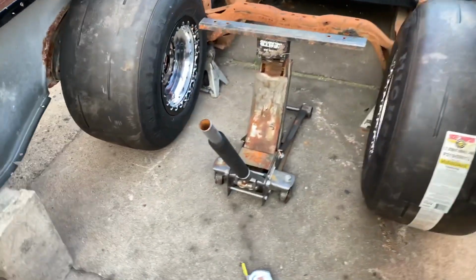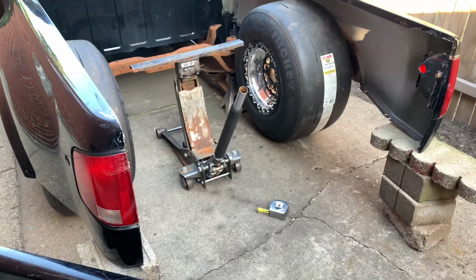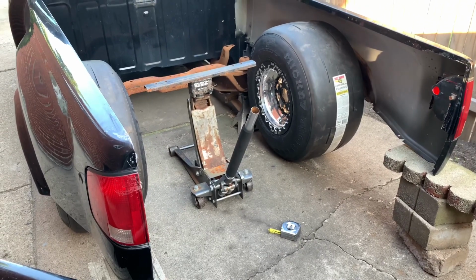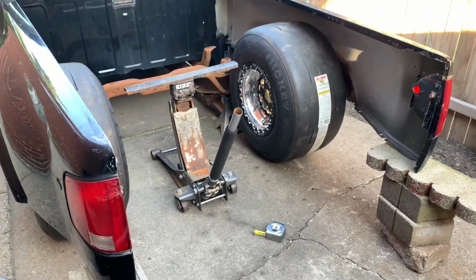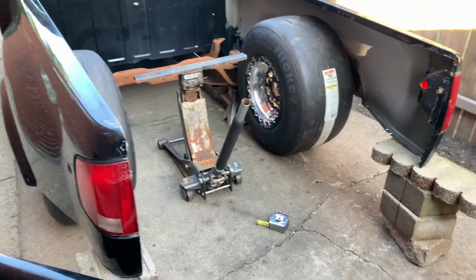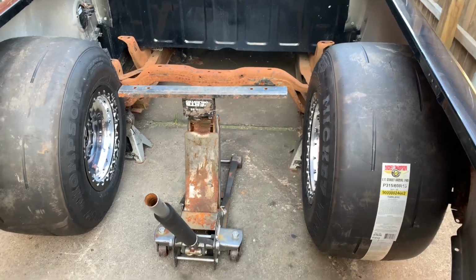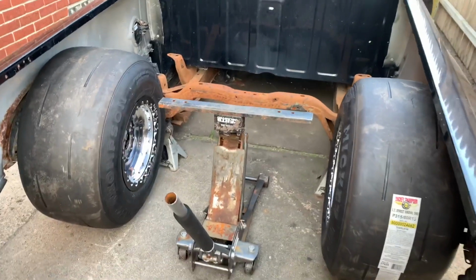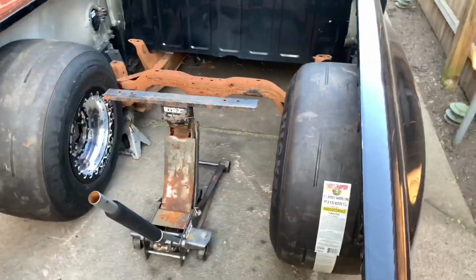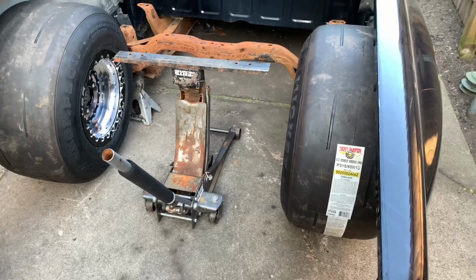There's probably a week to 2 week build time on the 4-link back half, so I should be making an updated video pretty soon. After I get that, I'm ordering the 40 spline high tough axles from Strange as well, because I'm running their 40 spline center section and spool setup. Within the next 2 weeks, I'll be ordering Strange's coilover strut kit, which is going to be pretty different, because I don't think I've seen anyone make that type of modification on one of these trucks.